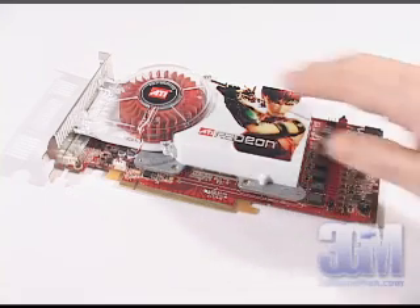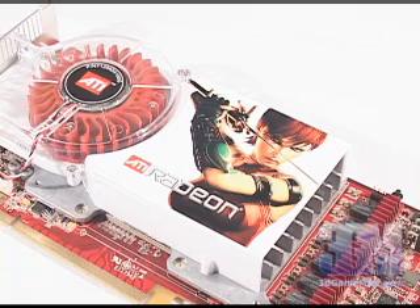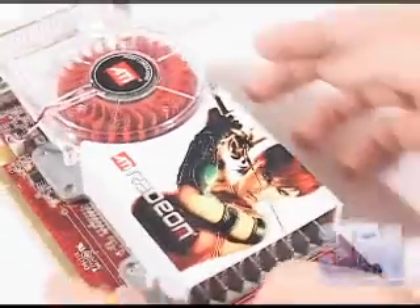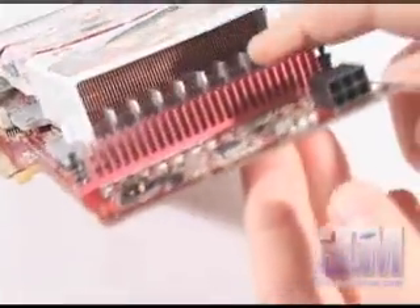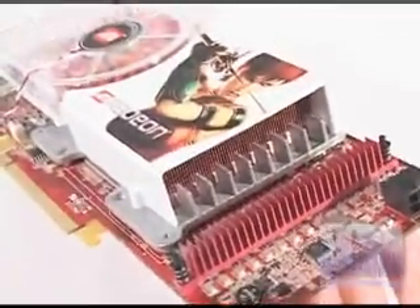This is a very efficient design that works really well and is used by many video card manufacturers. The fan is also temperature-controlled, which means it automatically adjusts the fan speed based on GPU temperature to achieve the best cooling possible. These high-end video cards get very hot, especially the core or graphics processing unit, so you need something really substantial to cool it. This card has a massive heat sink with an aluminum frame, copper inside with many fins, that comes in direct contact with the core and the memory, resulting in exceptional cooling power.